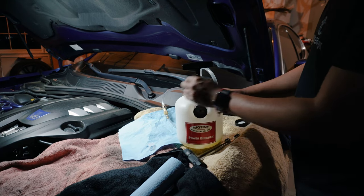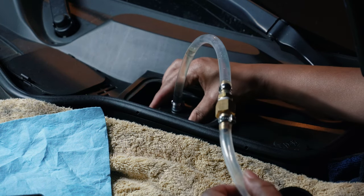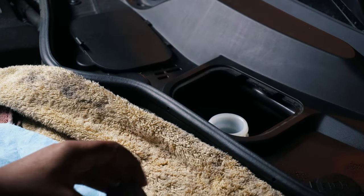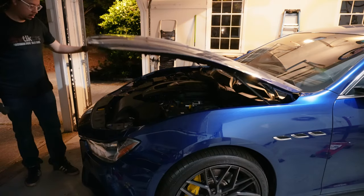The pressure is off — go ahead and seal the reservoir. Be very careful pulling the bleeder cap assembly off since there's fluid in it; loosen it very slowly. To check the fluid level, shine a light down into the reservoir. Once it's at the proper level, put your cap back on and you're done. If you enjoyed this video, give it a thumbs up, check out the other videos, and remember — do it until you can't. Until next time!